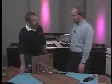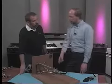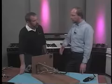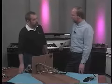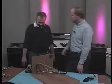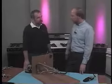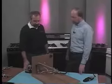Now, with this type of regulator or this type of shutoff valve, it'll always be located on the back of the appliance. I told you it has to be accessible from the front. There are holes where you can reach your finger in there and flip this up if you know where it's at. So you have to either be psychic or look at the mini manual. Either look at the mini manual or if the customer has the installation instructions, it's normally in there also. Oh, okay, good. And we're in the process of adding this to the user manual also.